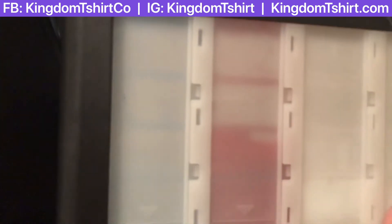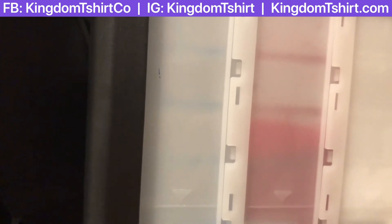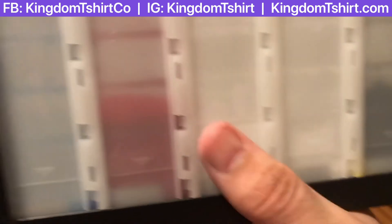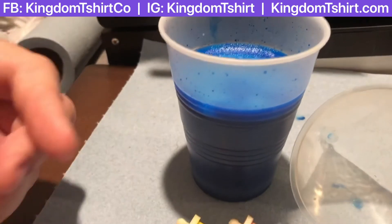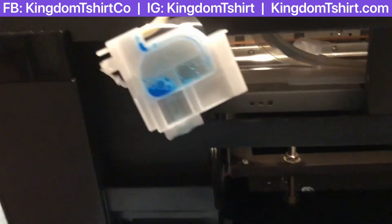I just finished with the cyan channel — as you can see it's completely empty and for the most part clean. You can see a little bit of blue still there but it's already clean enough to put new inks in. I still need to clean white, red, and black — black is going to be crazy — but this is what you do when you want to change inks. This is everything I took out: ink solution plus water. I'll dump this and then put a little clean water in to suck out the last bit.